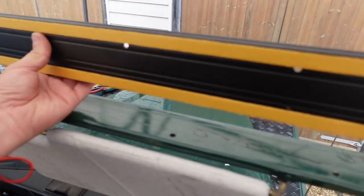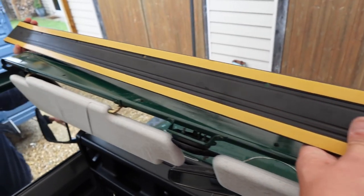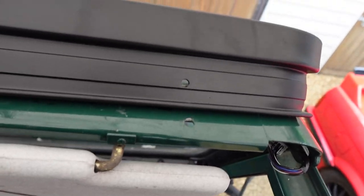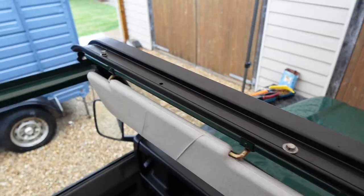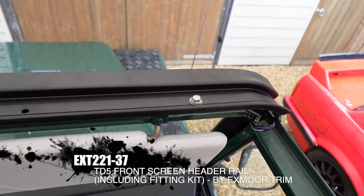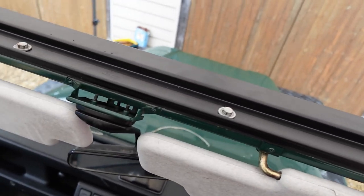If I just spin this round to show the viewers — we put some double-sided adhesive padding on there. The first reason is to stop water ingress from underneath the bar, but also to hold it in place. All the holes are lining up. You do need some weather protection underneath this rail, so we've used a foam strip front and back. I only had four captive bolts so we've only put four back — you have six holes but you don't need all six. Once it's in place it stays in place and doesn't clamp the canvas like the older version.